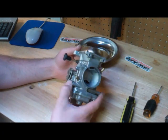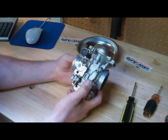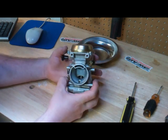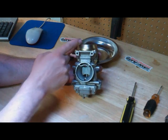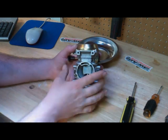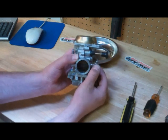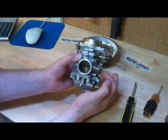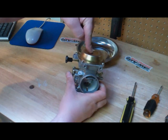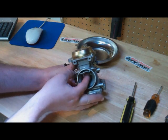This is a typical motorcycle carburetor. I'll forego the steps to taking the carburetor off the bike, as they vary so greatly from model to model. This is a typical carburetor called a constant velocity style, meaning there's a diaphragm and it's operated by engine vacuum that actually opens and closes the slide here, depending on how much air is running through the carburetor, operated by the butterfly here which is connected to your throttle cable. Other types of carburetors have a mechanical slide where the throttle cable goes through the top of the carburetor and operates the slide directly.